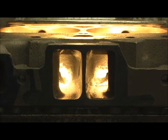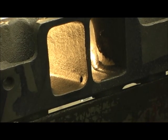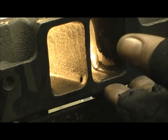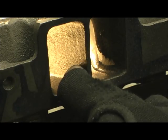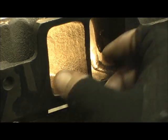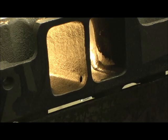Or where they're supposed to be on the roof line, I'm going to give you a hint. See that hole right there? That's where the valve cover bolt hole goes. On a stock set of Chevrolet cylinder heads, if you put a 1205 entrance, that has to bust through. If you don't see that busted through, then what they've done is they've given you a funnel — they've made the outside of the port big and pretty like a 1205, but when you come inside here, the airflow and the cross-sectional area just isn't there.